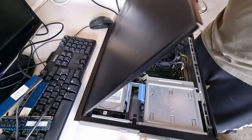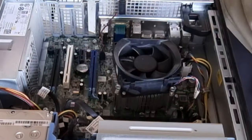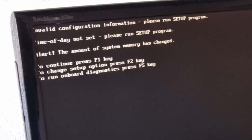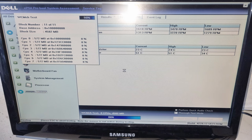Next up is the second unit, which showed different behavior in its power LED. The amber light blinks twice and then 3 more times before repeating, meaning we got some bad RAM, dirty contacts, or badly seated RAM. So I removed all RAM sticks and installed just one of the computer's own RAM sticks, and this time we got video output on the screen in the form of an error message mentioning a dead CMOS battery, meaning the time, date, and custom settings were lost. After reinstalling the RAM sticks, it recognized all 8GB of DDR3-1333 memory. I then ran Dell's built-in diagnostic utility, and after some time, the machine passed the test with success.